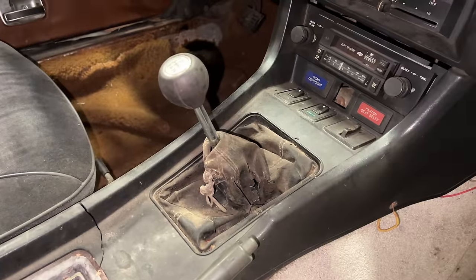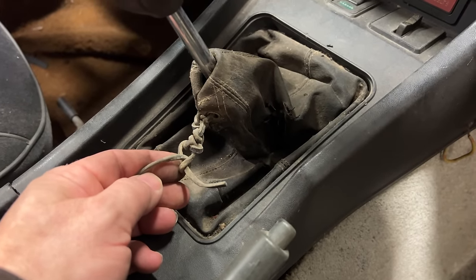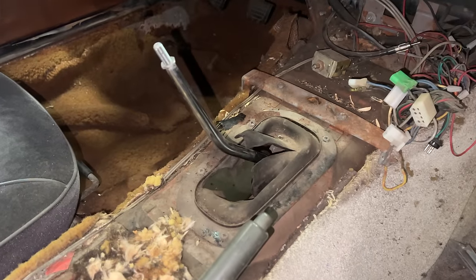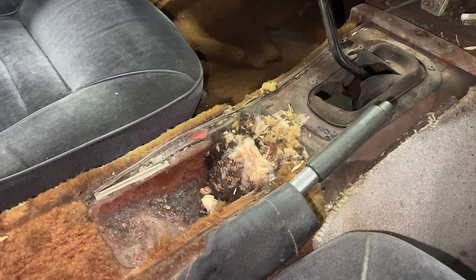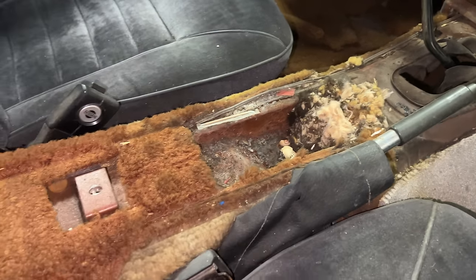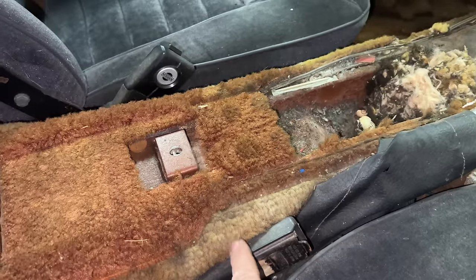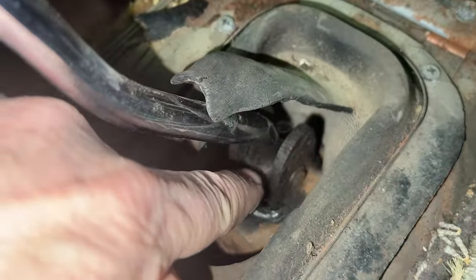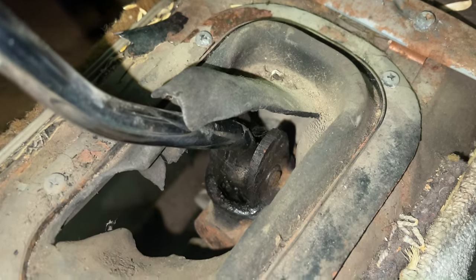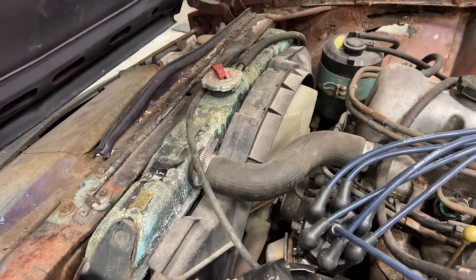On the inside of the car the shift lever needs to be removed. If I undo this lacing I might be able to get to it without having to take the center console out. Unfortunately it was a bit much to reach down that boot so I did take the center console out. Found a big old mouse nest right there. You can see the color change in the carpet from where the sun has ruined it. There's just a pin that goes through the shifter and a clip on this side that holds it in.